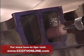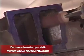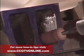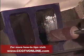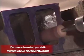I could use a carbide burr if I really wanted to make short work of this, but I'm going to start out with an abrasive roll instead. Keep in mind that if you get a little impatient, a carbide burr can take off a lot in a hurry — so unless you're willing to put in some seat time practicing on a scrap head, don't mess with them. The abrasive rolls may take a little longer, but you won't run the risk of seeing the inside of your water jacket with them.